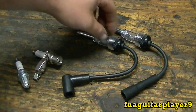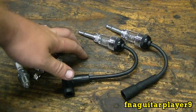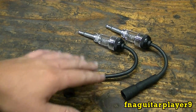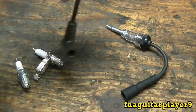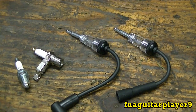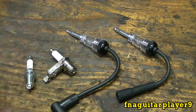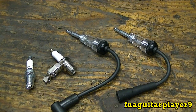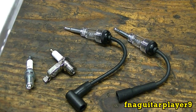These two are inline spark plug checkers. A lot of people told me I should get them because they're more accurate for diagnosing spark problems — you can actually check for spark while the engine's running. So if you get an intermittent spark or a miss due to a spark problem, these will tell you. There are two different types: this one is mainly for lawn mowers because of the angled plug, and this one is more for vehicles. These are five dollars a piece, so for fifteen dollars you can basically get a universal spark checking kit.